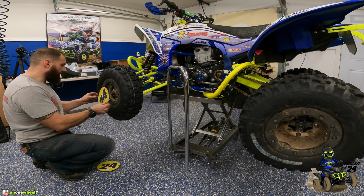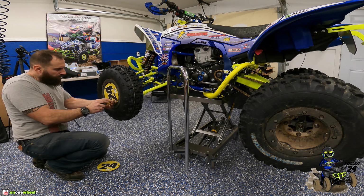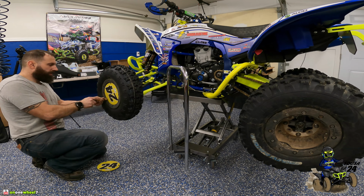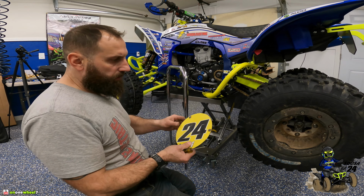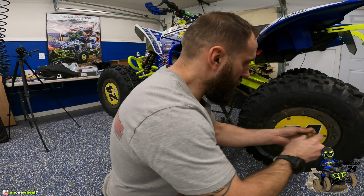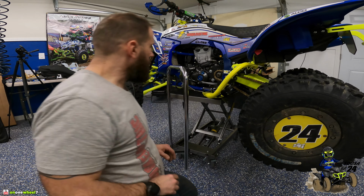She will be good to go. I have to just pump all the grease fittings up on the A-arms, the linkage, the pivot bolt. We already did the stem clamp. I did that before I put the tank on, but we got to grease all the other points, the A-arms and all that stuff, get it ready. And I think we are good to go for our first ride.